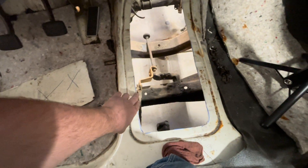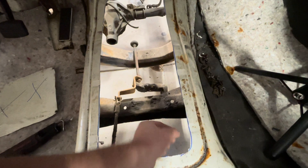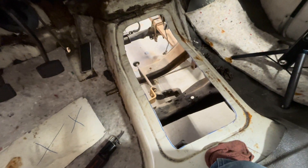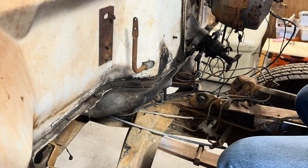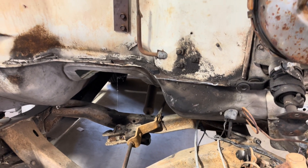For starters we just did a pretty rough cut to get the panel out of the way so we can get the trans and everything in here. We'll go back and clean up these edges, and on these little flat spots is where the clips go — you'll drill holes, then the high hump cover goes right in here and we put some butyl in here just to seal everything back down. That's basically how you convert to a high hump. Next thing you can cut out here is this pinch seam for the up pipe clearance.